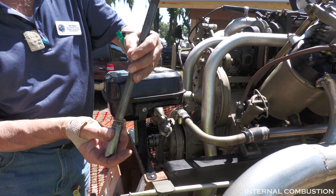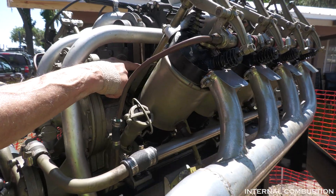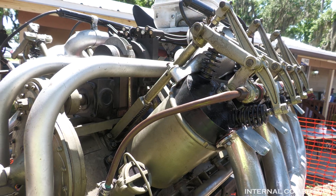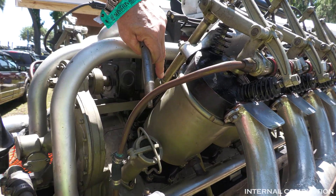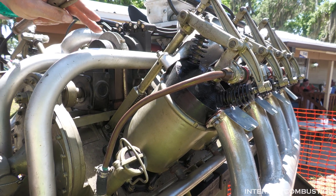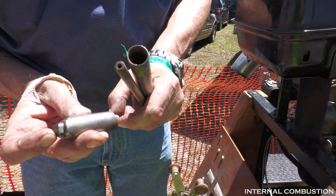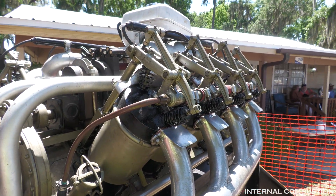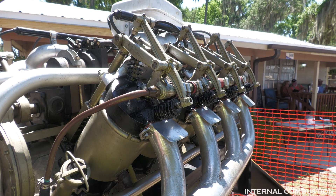This spring here is stronger than the intake valve spring, so when it reaches the flat spot on the cam, it pulls the whole assembly down and opens the intake valve. When the inner portion of the lifter body pushes on this push rod, it opens the exhaust valve.